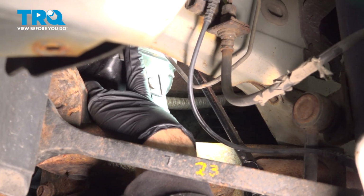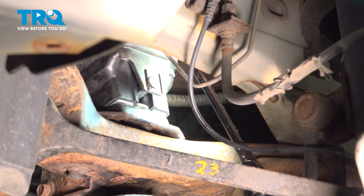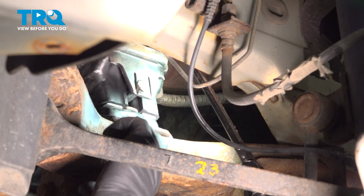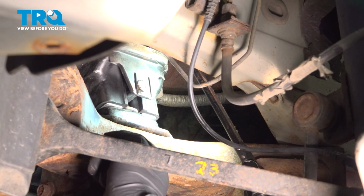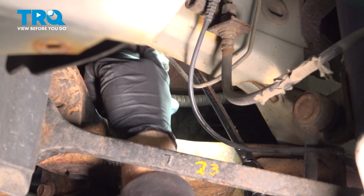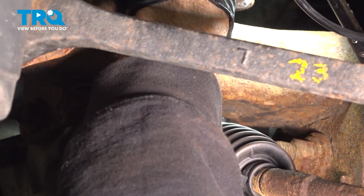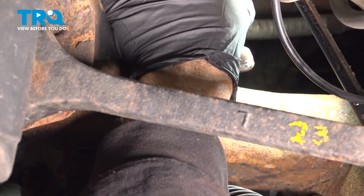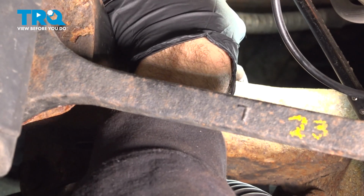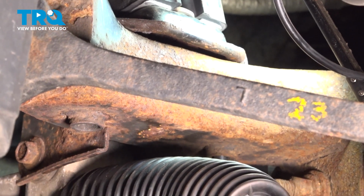At this point, what we're going to do is go ahead and use our screw jack to raise up that motor just a little bit. And what I'm going to do is get our two vertical bolts to go in through the bottom and catch the mount plate on the bottom of our mount here. Just get those caught, and then we'll install the two bolts on the top going into the side of the motor. I'm going to go ahead and install our bolt here. Now, our initial bolts were compromised, so we went ahead and sourced two new bolts to replace what we had in there.